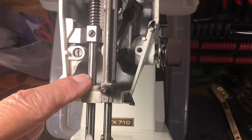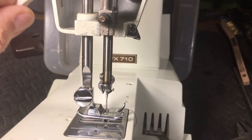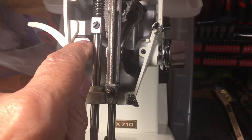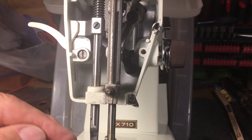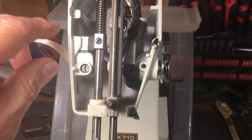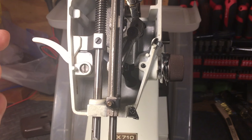If you override the height you get into problems trying to force the hand wheel and break an internal part. Be cautioned: when this presser bar lever gets to its maximum height, that's as high as it's gonna go — adjusting this screw won't increase the lift. All it's going to do is affect whether it touches the fabric at the bottom. When it's down and flush, that's as low as it'll go; when it's making contact raised up, that's as high as it'll go.